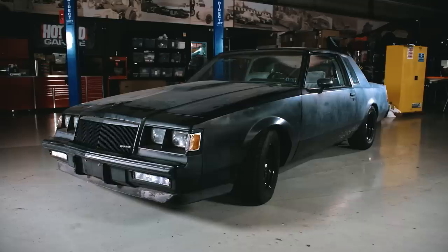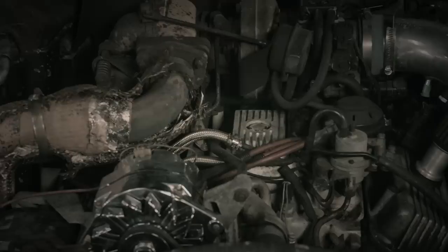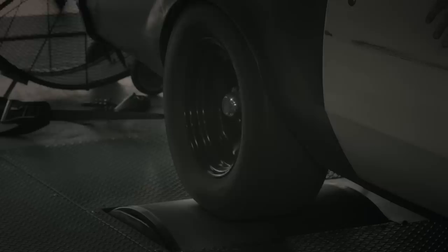The plan for this week is to dig into the trash. We are dumpster diving with the Grand Trashional, trying to find some power. On the first episode, we got the cheapest running turbo Buick in the country for $3,800, started with interior and rust repair, went to the track and did 14.83 at 96.86 miles per hour. Episodes two and three, Tony and Jimmy swapped to an '87 motor, intercooled, bigger turbo, Holley controls, Gearstar transmission, but still only made 255 wheel horsepower at 16.5 pounds of boost. That leaves so much room for improvement — because we're here to do that.